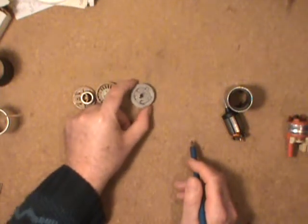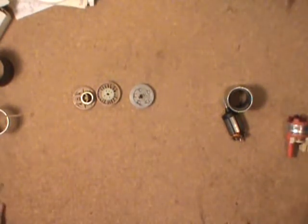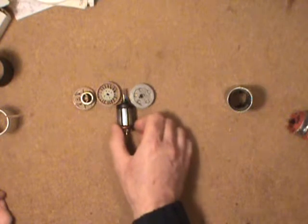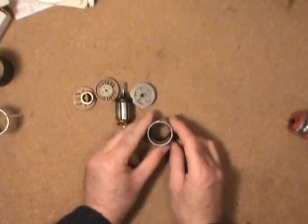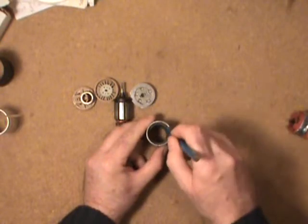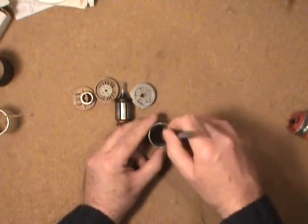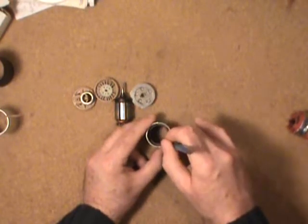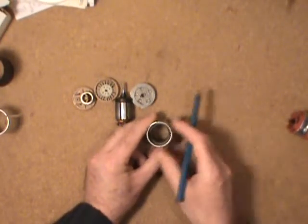There's the high pressure pump — I bet that thing can do 100 pounds per square inch, no problem. But there are regulating check valves in here that I'll show you in a few minutes. So there's the motor armature, and here's the housing with two really strong magnets in it. They're C-shaped, and there are two hardened spring steel clips that force the magnets into the housing so they're fixed in there by the pressure of these two spring clips.